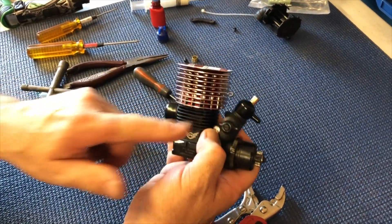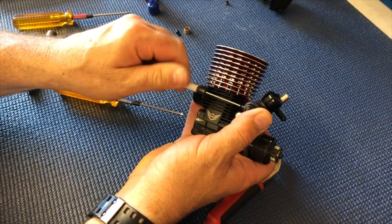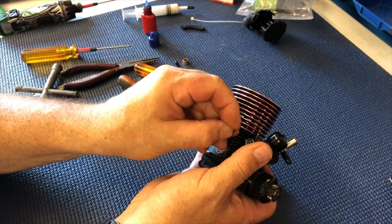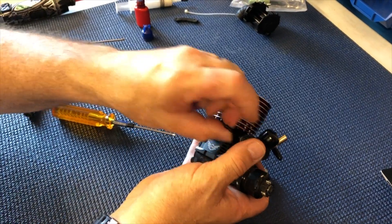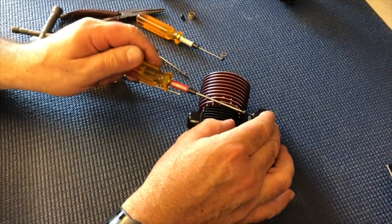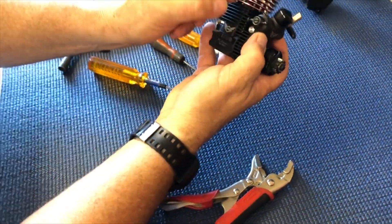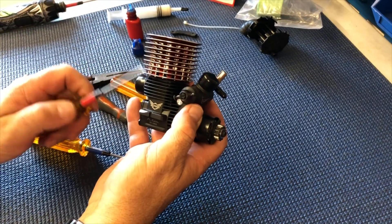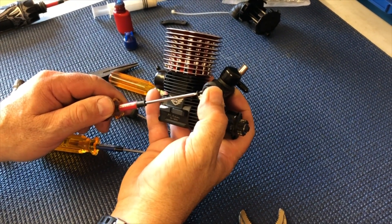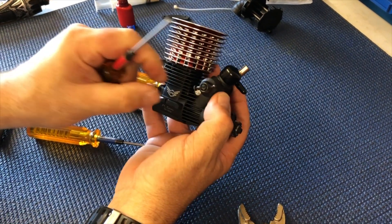With the ball joint, I take off the set screw and get a little M3 button-head screw with a 2mm hex driver. Put that on the driver — it's easier and I can show you what angle and height is right for the MP10 mounting so that you get a level, even opening flow. I point it up so it's just where the silver part of the clamp bolt on the carburetor is — that's your right height. Just nip that up gently like you would with a grub screw.